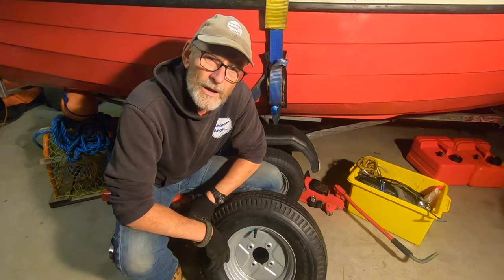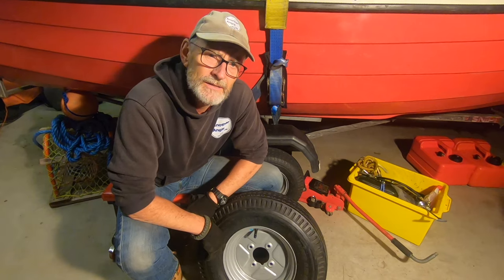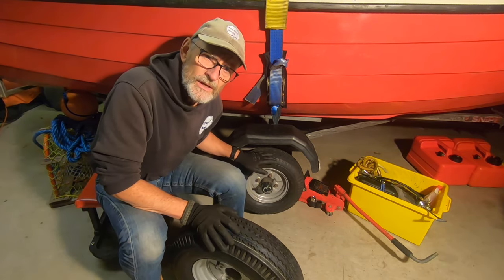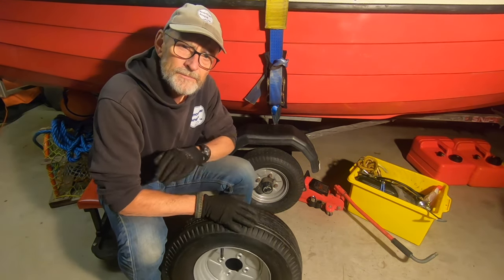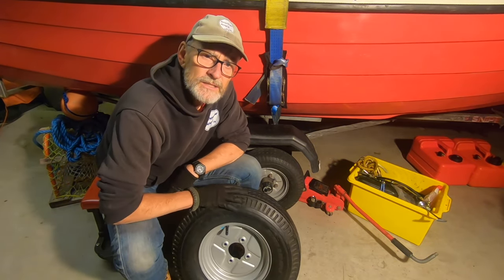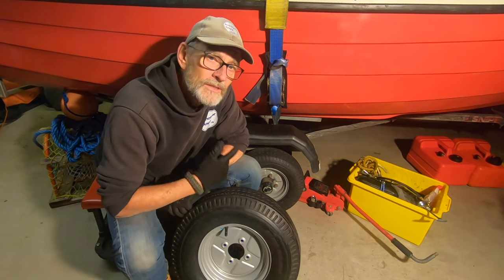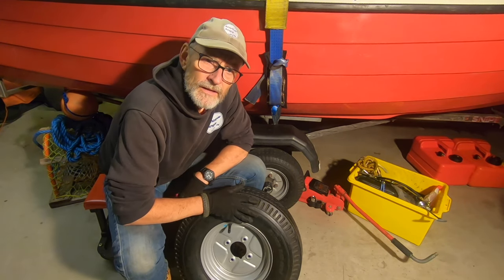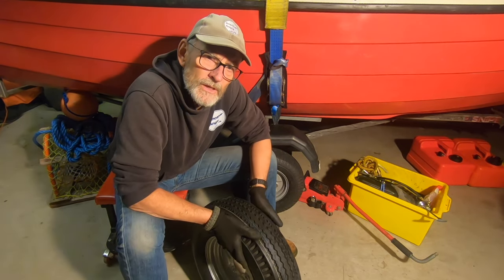It's quite nice if you've got two trailers running on exactly the same tires, you can swap things around. One of the things I do with the boat when it's here in the garage is I put it on axle stands so I've not got the weight on the tires creating flat spots — just lift the weight off the wheels and suspension. That helps the long life of everything, so if I've got 8,000 miles out of the little 8-inch ones, I want more miles out of these.